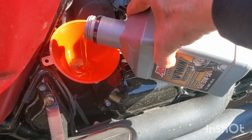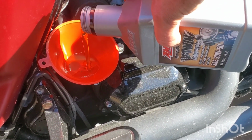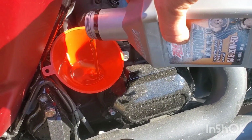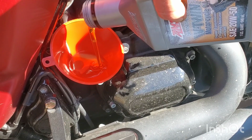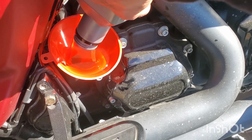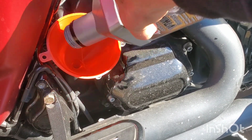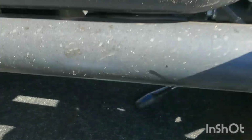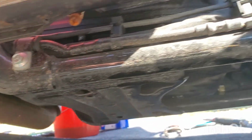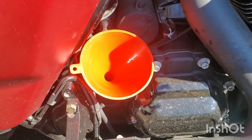All right, starting with the quart that you used to put half a quart in the oil filter, we will put in exactly 4.5 quarts. I will run it. Once it gets hot, I'll check it. See where we're at. Oh, we had some good AMS oil. Some good looking oil there. Just to make sure nothing's coming back out, because that would be a waste of oil. All right, I'll put in 4.5 quarts and we'll go to mess with that primary.